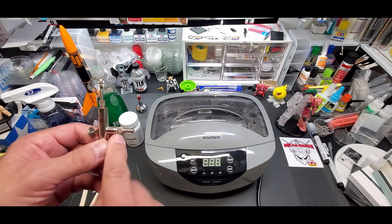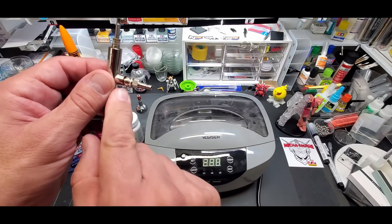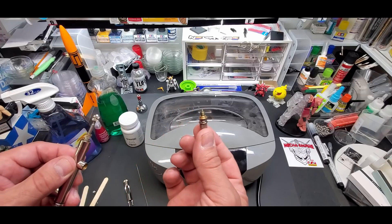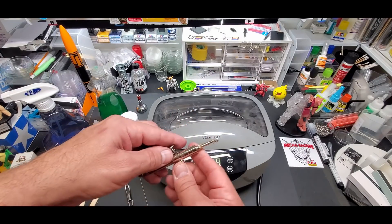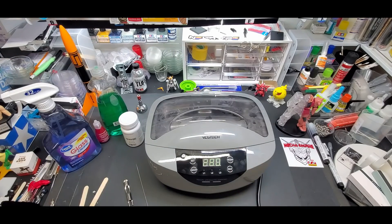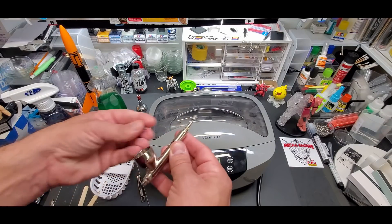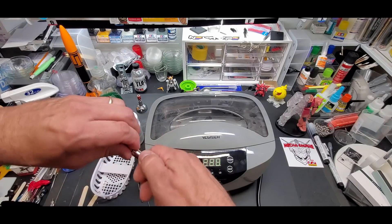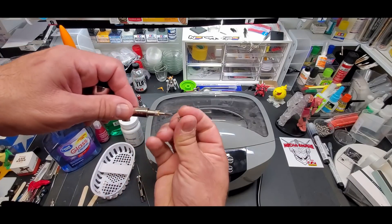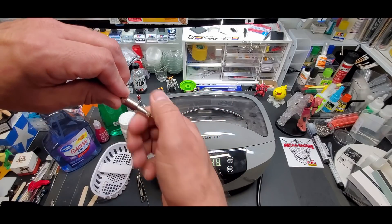We're not going to clean the air valve — take the air valve out if you need to, use a little plier, be careful, and undo it right here. That's the air valve — put that aside. Everything else can come out. With this basket it's a little large and small pieces are going to go through, so get yourself a little basket — I happen to have one from the older, obsolete cleaner. You can leave the screw that holds the needle in; let's take out the entire spring mechanism.